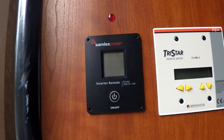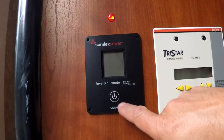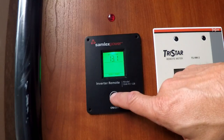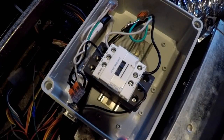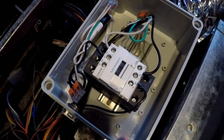Generator's running. And it should turn on just here in a second — there it is. Converter is on. Can you guys see that? The little red light is on. Now I'm going to fire up my inverter, and we should see the converter automatically shut off. Turn that on — awesome! Light went off and I can use my inverter. Now when this shuts back off, we should see the little light come back on. Converter — yeah! Sweet. Let's do that again. Switches to inverter, and then back to converter. That's awesome.